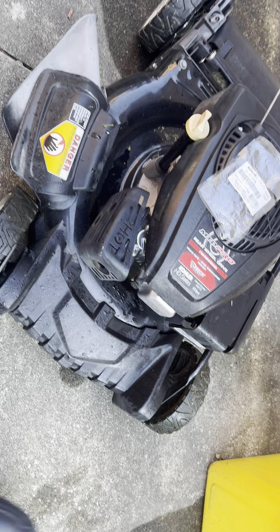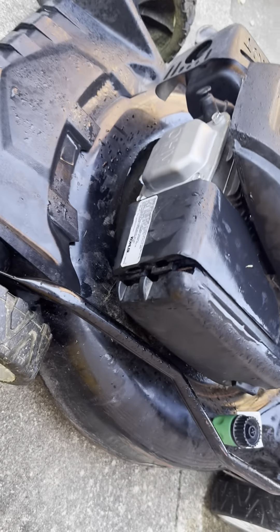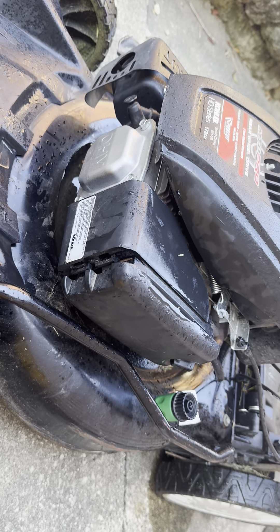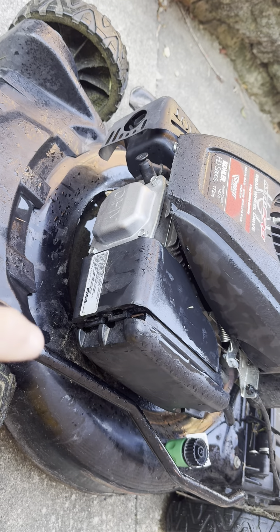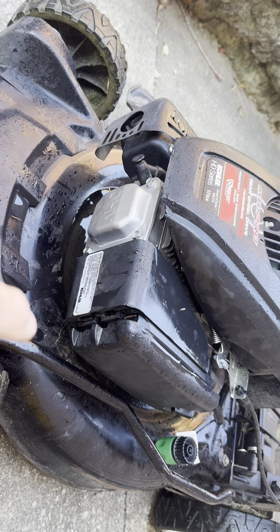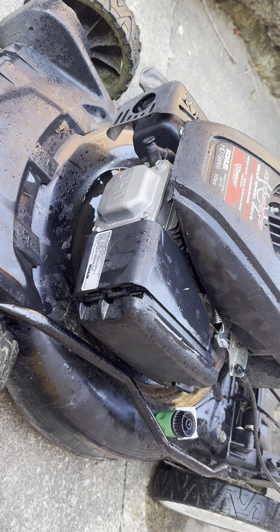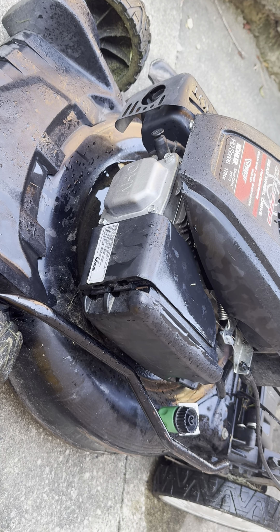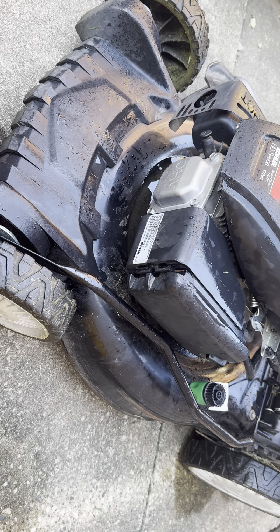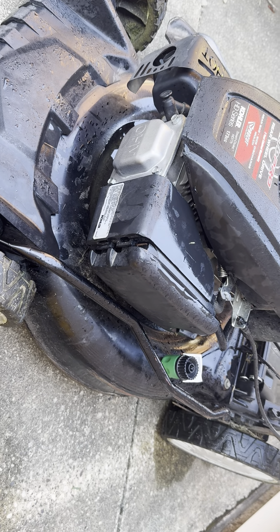One last thing I'll say is that these airboxes are a vulnerability in a yard that's full of trees and bushes. This one was clipped by one of my staff members in the household and broke this casting on the airbox. I think that can also contribute to some performance issues, just because it's not sealed correctly — the engine will run more rich in that condition as well. Those are my thoughts. Clayton from Dubuque.